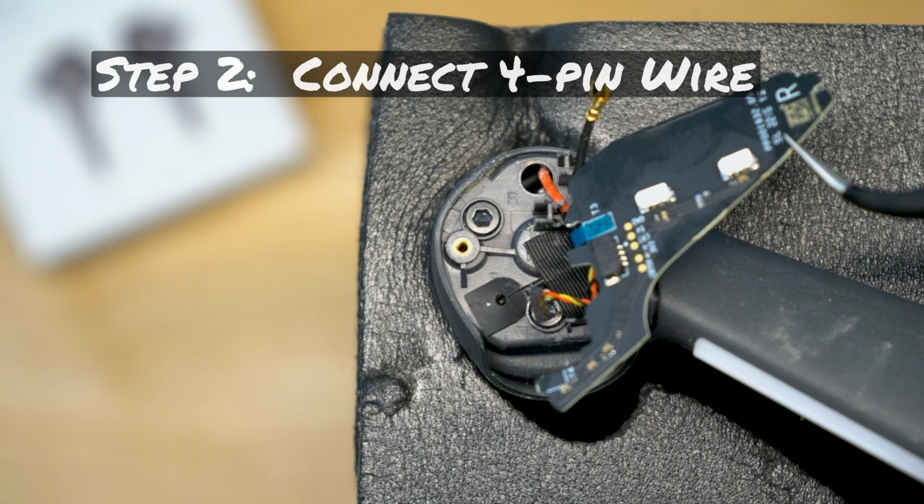So here is the sticker, and it will actually mount to this part here. Let's put this on this side here, and this will mount here like so. As you can see, the sticky tape attaches to this post here. Step 4. Attach the image transmission feeder wire to the antenna board using the metal connectors. Did you hear that click? It's in place. As you saw, using tweezers helped greatly, as well as this video to zoom in on the parts.